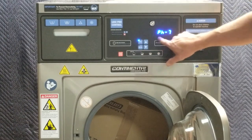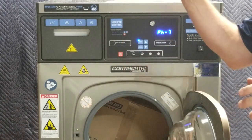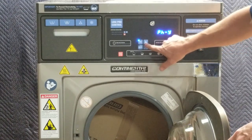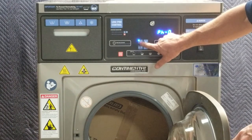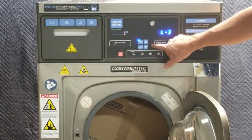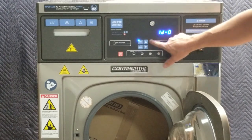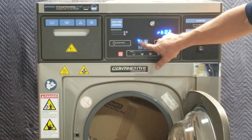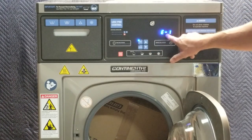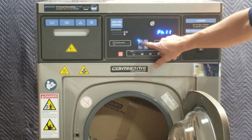Phase six we're going to turn off. Phase seven — you can pick and choose to a certain extent, but keep in mind the first few phases are wash and the last few are rinse and spin. Phase seven is turned on — I'll turn it off. Phase eight is off. Phase nine I'll turn on — making the program using a total of four phases. I'll scroll quickly to level three. 32 degrees is fine once you get into the rinses; you don't need hot water, no dosing, agitation still high, rotation time about eight minutes, no rinse hold, and a simple drain.